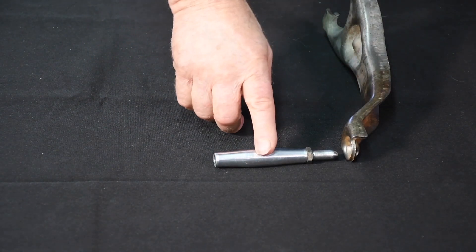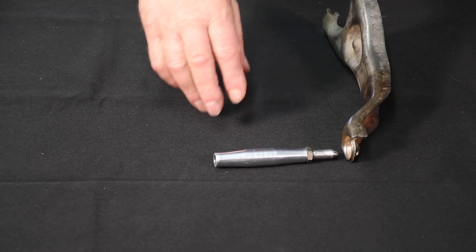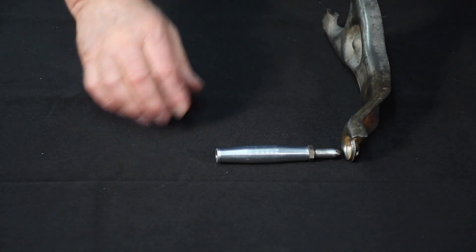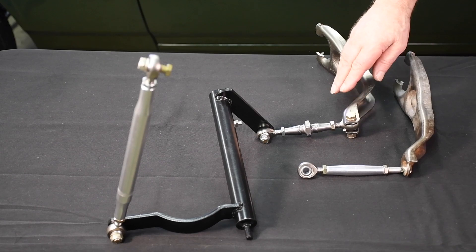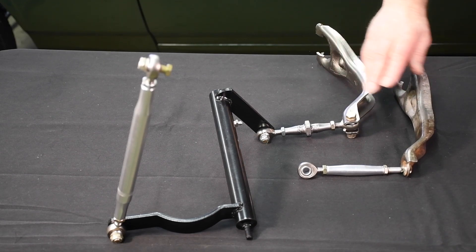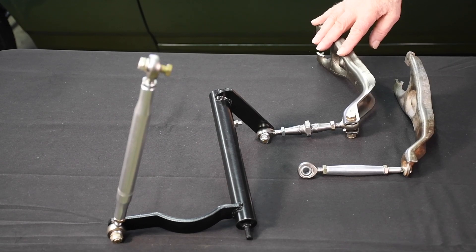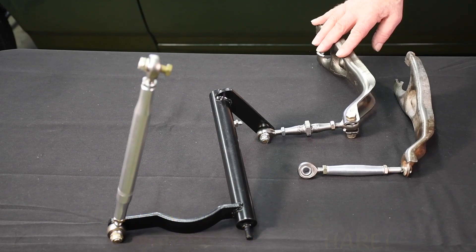As you can see, I used a short section of swage tubing along with the jam nut on the end. The ball end bolt goes right into the swage tubing. This is what the linkage looks like assembled in the z-bar — it's both types of linkage, one for the Corvette style of fork and this one for the Camaro fork. It's easy to adjust and easy for you to build at home. For more down-to-earth tech that you can use, please subscribe to Lone Wolf's Hot Rod channel and please share. Thanks for watching.